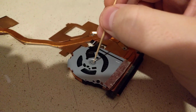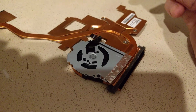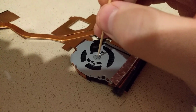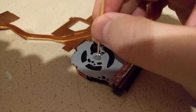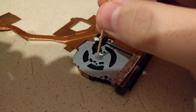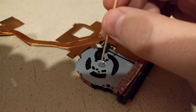What I've known from past experience working with PC hardware is that the sleeve bearing fans, when they make that noise, it doesn't necessarily mean that the fan's completely toast and needs to be replaced. It really means that you need to get in there, clean it out, and replace the lubrication. I usually find that using a heavy grease will work best because the greases won't typically evaporate over time. They do have higher viscosity, which means the motor has to work a little bit more to bring the fan up to speed, but I've never really seen it where it's slowed the fan down. This fan, for instance, typically runs about 5,600 RPM, and that's what I see even after packing this with grease, so there's not really any fall off there.